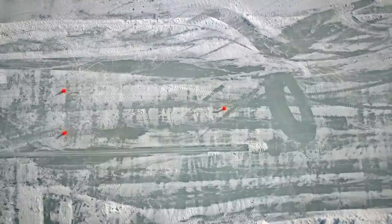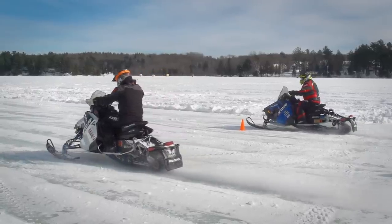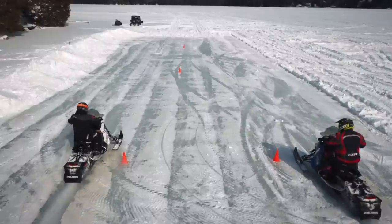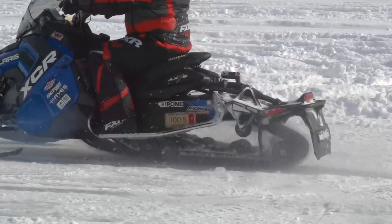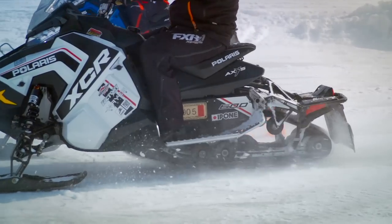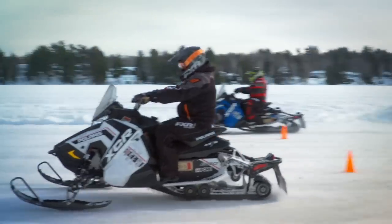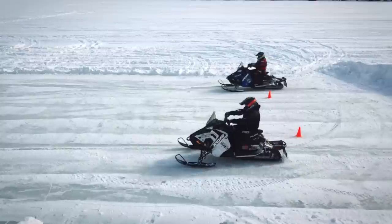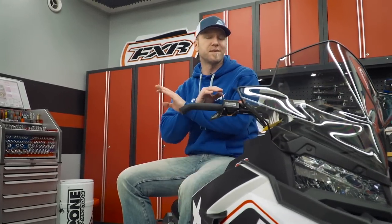Round two is leaving from a completely ice surface. I can't even count how many times I've been riding and found a polished lake or portions of it where an unstudded sled gets a bit squirrely. Side by side, the 800 is working like a Zamboni to polish the ice to a mirror finish, while the 84 Gold Diggers are able to cut through the surface and propel the 600 forward with ease. When snow is abundant there's not a whole lot of difference, but if you encounter ice, there's absolutely zero comparison.